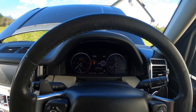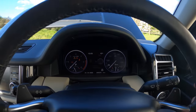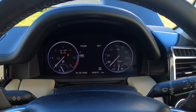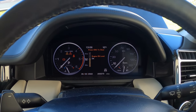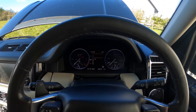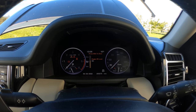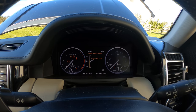In order to check the oil level after we've done that first top-up, put the ignition on with the bonnet open, clear these messages using the right-hand button, go into the service menu and open up the oil level display. You can also press the cruise control cancel button twice to get the oil level display. It's telling us the oil is okay — a couple of bars below max — so that's not a bad place to leave it. I'll run the car for a day or two and top it up if needed.